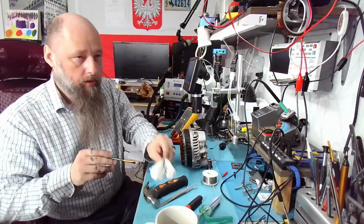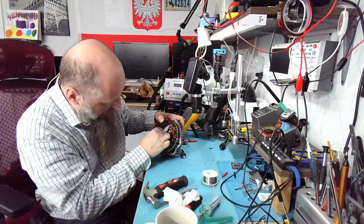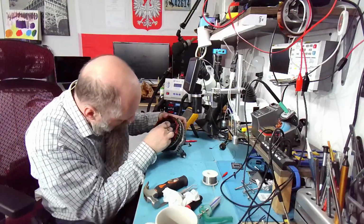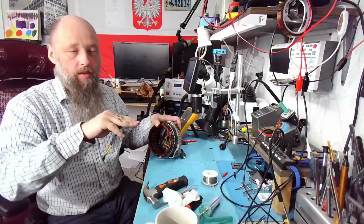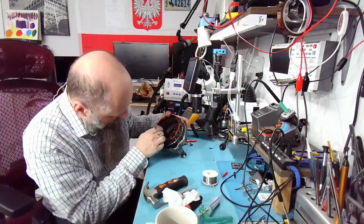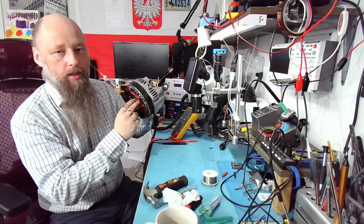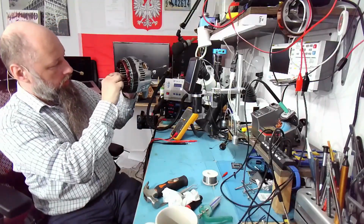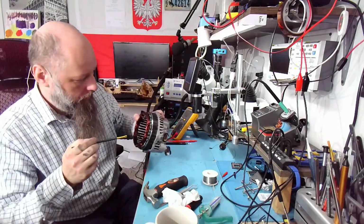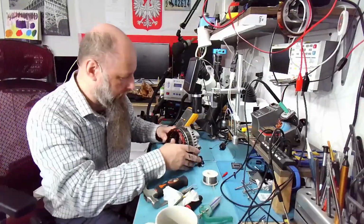Always clean the bearing or the bearing housing over here, because if there's any particles or anything, it'll be tough to put it back on, and it might not be good, because if it's even slightly off-centered, there's going to be vibrations, and it might over time just destroy your alternator, and it can trickle down to other components. You know, in the cars, it is important to replace certain parts together, because one issue can cause another issue and another issue, and it's a cascading effect.